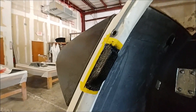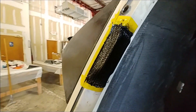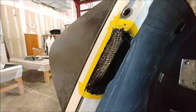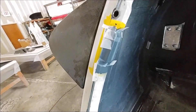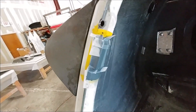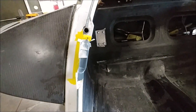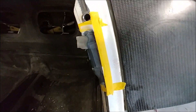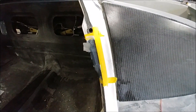There's one of those hard points in the door ready for the layup, and here I'm halfway through doing the layup — just putting one layer of medium carbon over that. That's ready to have peel ply on it, and here's what it looks like when the peel ply is done. I just put a whole bunch of small pieces on there for really good coverage so no spots get missed, and when you pull it off you get a nice neat finish with hardly anything left to do.